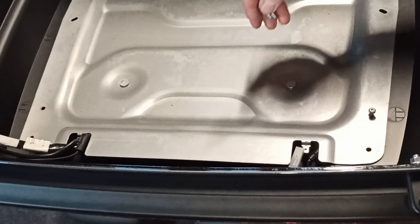They're all blacked out down there now. The next thing to do is turn the bike on, hit your flashers, and let them run for 10 minutes to sync the system, then shut it off. Once the sync is done, turn the lights off and check: running light, brake light, right signal, left signal.